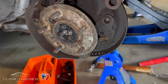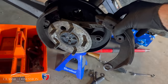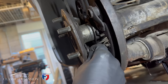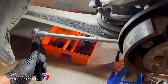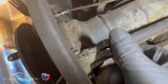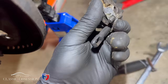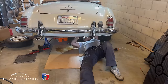You can see here the pivot wheel is well gummed up, completely seized, and obviously hasn't moved in years. So it's off with the shoes, off with the cable, and then this housing, like I've said before, over years it becomes powdery and brittle, so they usually break when you take them off. And as you know, things are never straightforward when things are rusted up and seized.